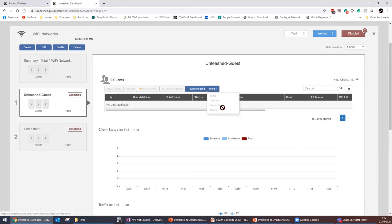You can also click More and start doing a speed test. If a customer rings up saying Wi-Fi is giving really poor speed, we can do a speed test and say, well actually between your device and the AP, you're getting 300 megabits per second. So there's not a fault with the wireless — there's a fault with the network. It's an easy way to start troubleshooting where the bottleneck is.